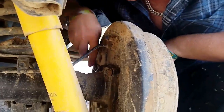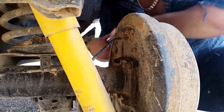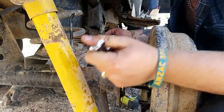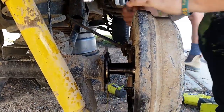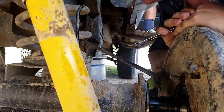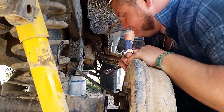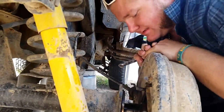Axle's almost out. The big issue we have with Surfs is that I need about an extra inch and it doesn't want to come. You pretty much have to undo every nut and bolt going up your handbrake cable for it to work, or the other option — if you're wrecking the vehicle — is grinding it off. But in this case that's not going to happen.